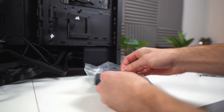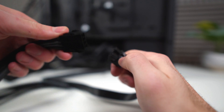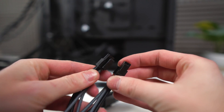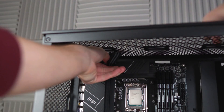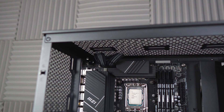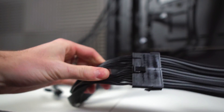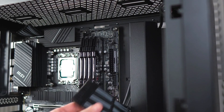This is totally optional — you could use the stock cables that came with the Deepcool power supply, but if you want a little aesthetic flair, you can get these easy DIY black and gray power extenders. The CPU cable goes through the top right cutout and gets plugged into the connectors on the top left of the motherboard. All power connectors go in one way, so if it's not fitting, flip the connector around. Next up is the 24-pin power connector — put on the cable extender and route it through the middle cutout, then plug it into the header on the middle-right section of the motherboard.